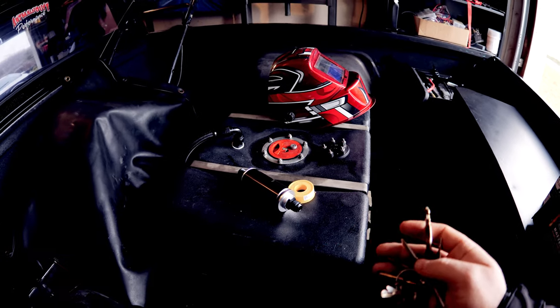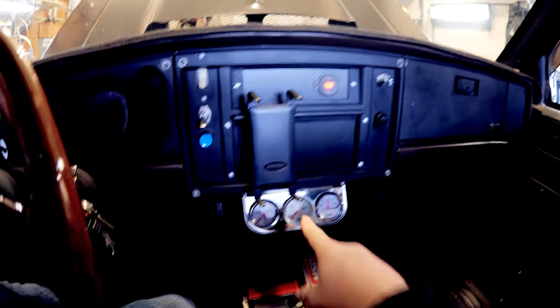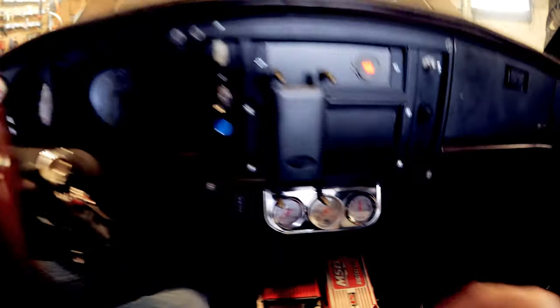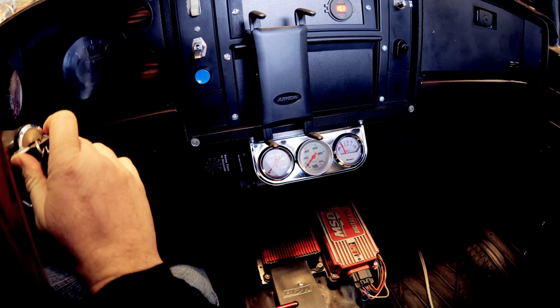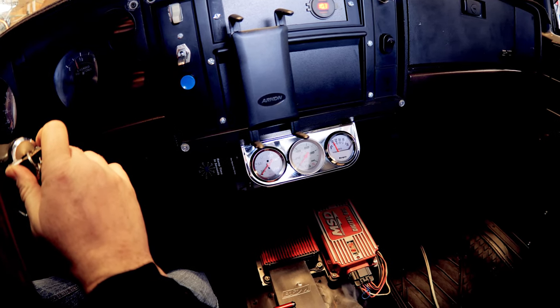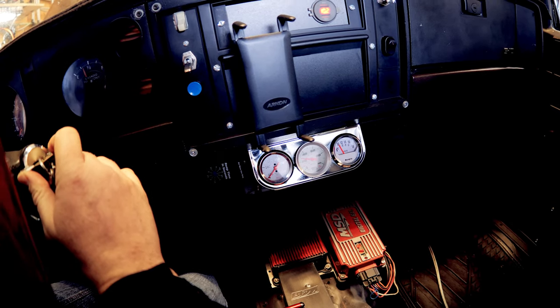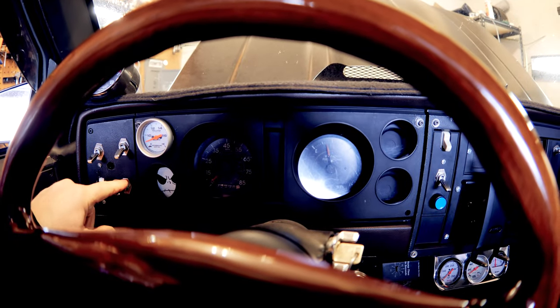Back to the cold start. We're sitting in the cockpit of this big fat tractor. I have 12.8 volts but also have no oil pressure, so first thing I'm going to do is just prime the motor until we have oil pressure. All right, now we've got oil pressure.